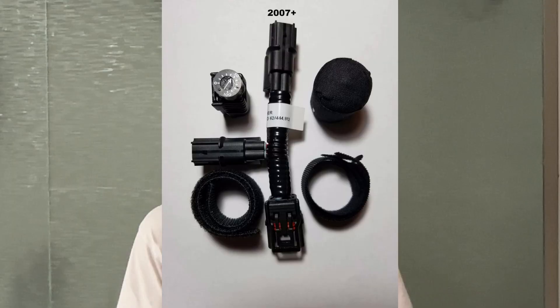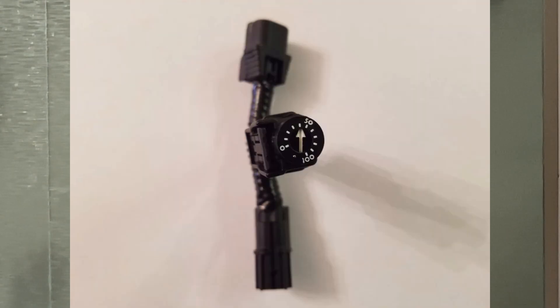The next passive device is the VCM Tuner. VCM Tuner is also plug-and-play and looks very much like VCM Muzzler 2. There is a resistor on the device with a dial so you can dial in the resistance — you don't have to keep switching resistors out. If there's a change in climate or driving conditions, all you have to do is adjust the dial. It is easier to adjust a dial than to switch different resistors, but you decide what your comfort level is.